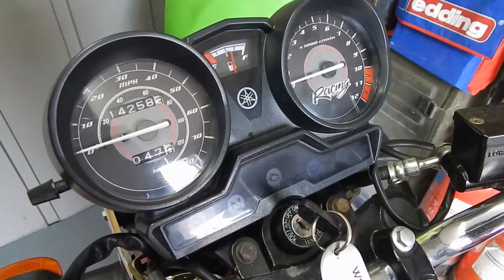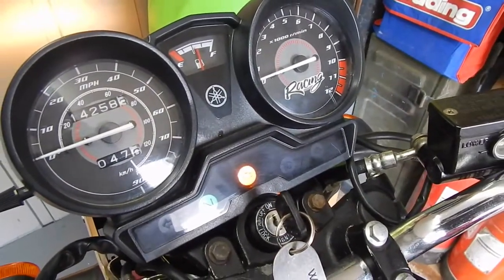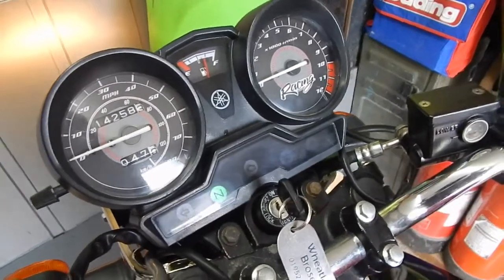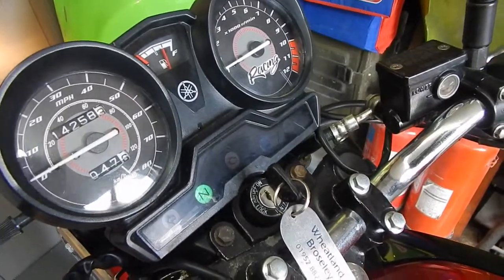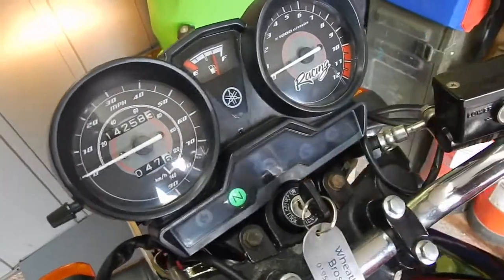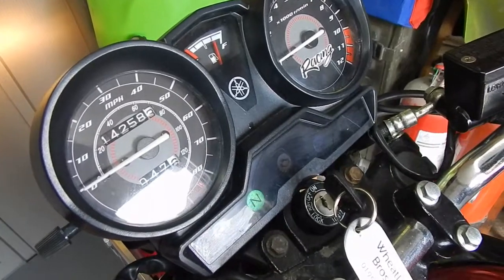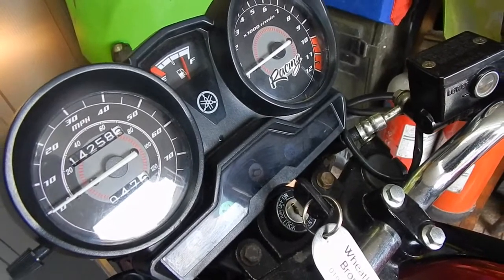A secondary thing for lights: newer bikes have engine management systems. This one illuminates for roughly three to five seconds and then goes out — make sure it does disengage properly and isn't displaying any error codes. On Yamahas, the light will flash in a pattern of short and long flashes to give you its fault code — worth checking. Also, if your bike is a two-stroke, you'll sometimes have an oil warning light. Always check your two-stroke oil reservoir — at least twice a week if you're doing higher mileage commuting.